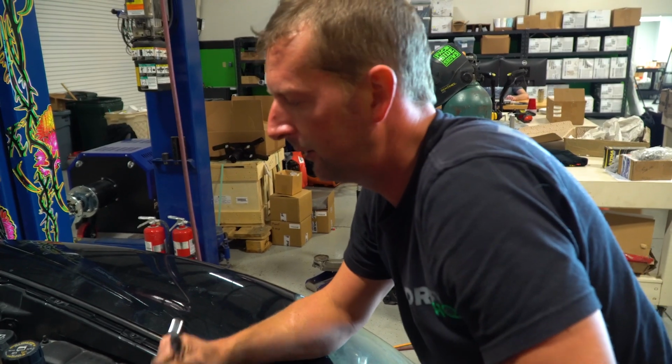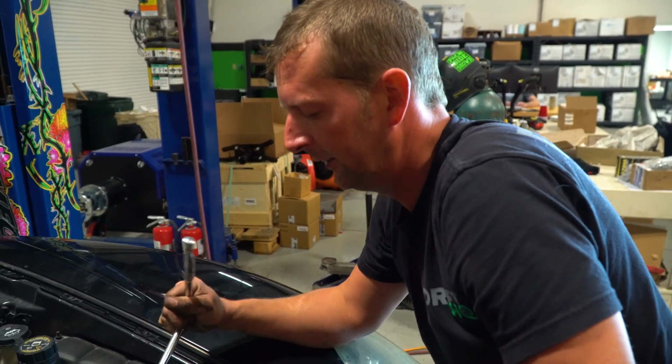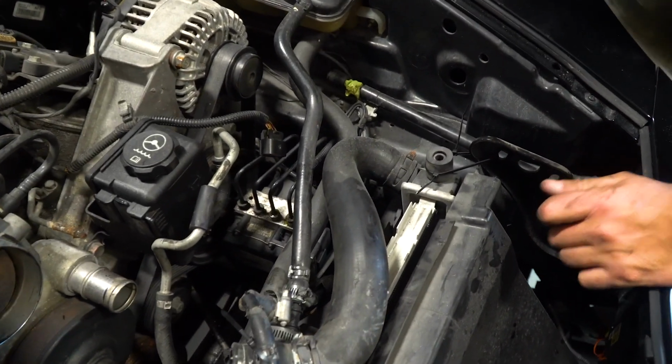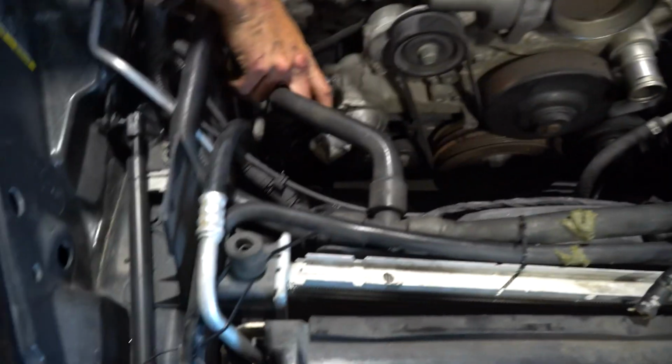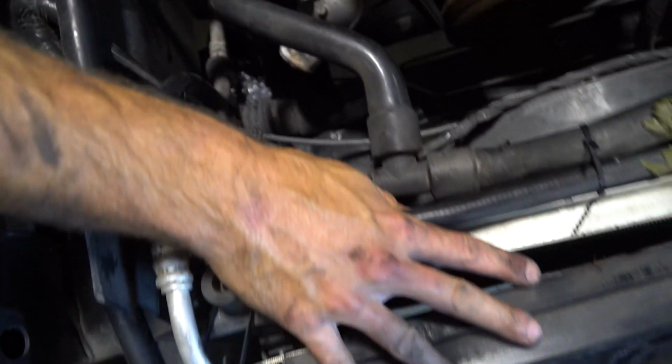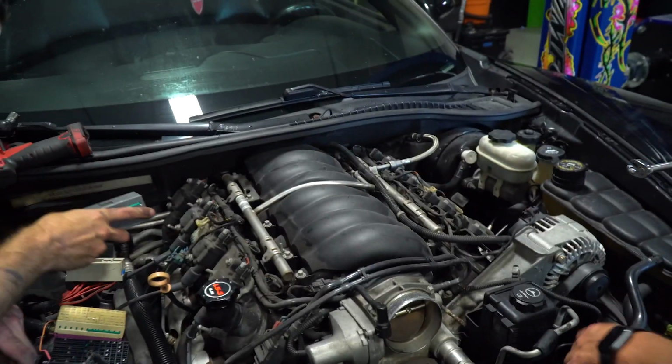So I'm just removing those 2, and then I'm going to disconnect it from the master cylinder with those 2 lines, and the whole assembly can drop out after that with no more. And also remove the 2 heater core lines here, which will also stay in the engine bay, as well as the radiator and condenser. So he disconnected the upper and lower radiator hoses, and we just zip tied them up on top of the radiator so nothing catches on our way out.